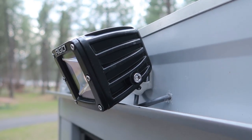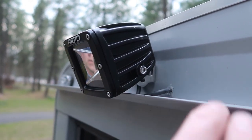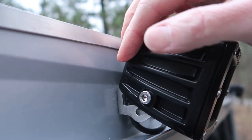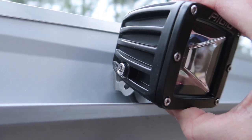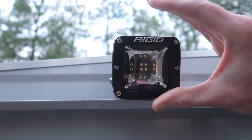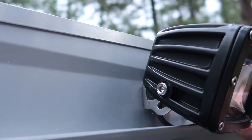Here's what the lights look like when fully installed — two holes, one for the mounting bracket and one for the wire. I drilled a small hole for the wire and put some sealant around it, and on the inside I also installed sealant. I positioned the hole for the mounting bracket so I could get it just a little bit down below this lip. That way I can swivel or tilt the light for a little bit of side lighting, which makes a small difference when backing up.